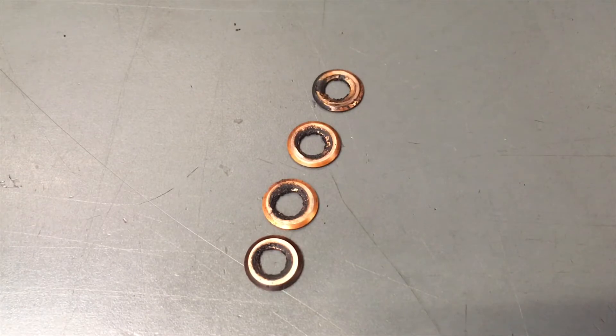By the end of 2007 they came up with a coating that made them last a little bit longer. How long they last isn't an issue. This set right here — they've done nearly 300,000 Ks. I'm not suggesting you push it out that far. You can see the top one toward the left side, that's where it was leaking. All three of them at the left-hand side are quite thin — the seating area is down from what's normally probably two to three millimeters to maybe a millimeter. They erode away in the middle.